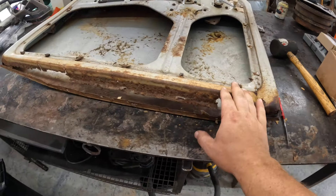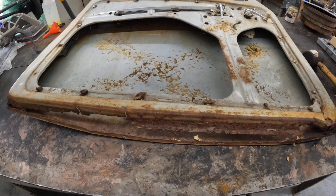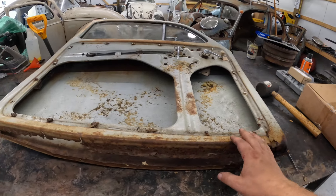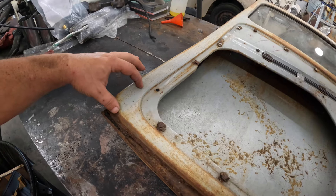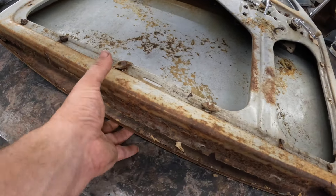This is what we're working with — this whole bottom inside door is just rotted and compromised. The door I have outside is a '66 but it's a passenger side; clearly we need a driver's side. I called my buddy Paul and from the '59 he has a leftover inner door replacement panel sitting on the shelf, so he's bringing that over — which is just how things work out sometimes. I tried to save the door panel but it was completely petrified, just kind of crumbling away. We'll just get new door panels for this thing when it's all said and done. The door skin's in decent shape — I think I'll be able to save it. We'll cut about five inches, put a new hinge on, replace the bottom, pull the skin back up, tack it, and the door will be repaired.